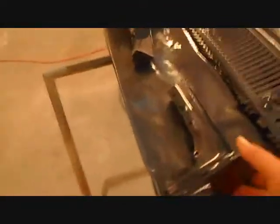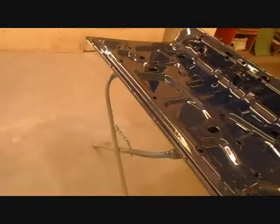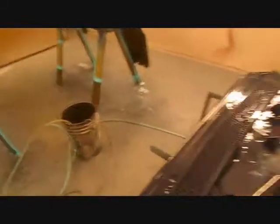These here I might re-spray because I saw a couple of little imperfections. I know it's not supposed to be absolutely showroom perfect, but some waves will show — like we originally agreed. It might be easier just to re-shoot these and have more clear on it, because this is a real hard area and we don't want to burn through. I'm going to bring the hood and deck lid in tomorrow or Wednesday, bring the car in today, paint the car, and get it completely done.